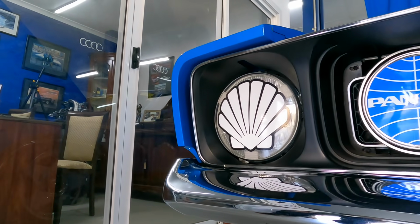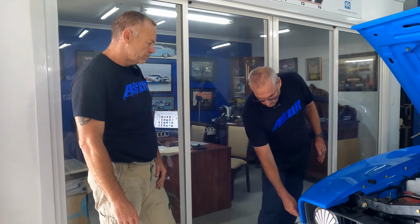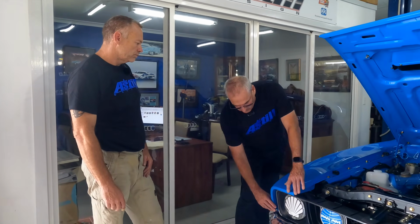So when the car's been moved, it's been pushed around the garage or something like that. It's been leant on and it's just moved under its own weight. So someone basically pushed on the nose cone rather than the bumper. Yeah, and it's just moved it. And once again, it's two painted surfaces, and it's got a very small, I think an 8mm nut by memory, that there's about 4 little screws in there that hold that together. It's just slipped on the paint.